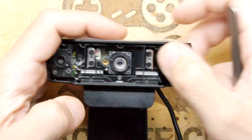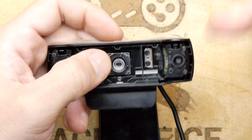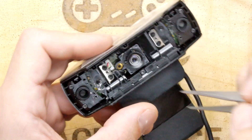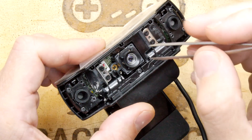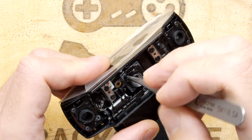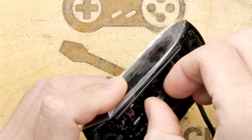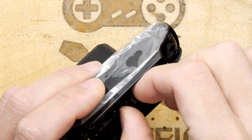I just confirmed on the computer: if you push the lens into the body it sharpens up the focus toward infinity; if you wind it out it kicks in more macro. If you want to see what the lens does, you can just twist it off — I put a tiny bit more force once I knew how it was working and it does loosen up. I think there's a little bit of glue in there, but you can spin it out like most webcams. I'll give you a top tip while we're here.